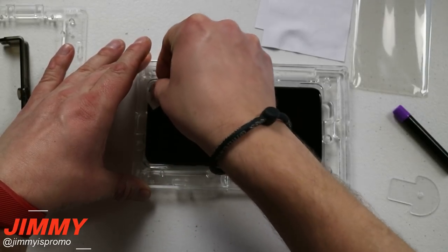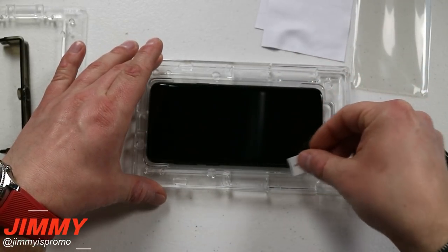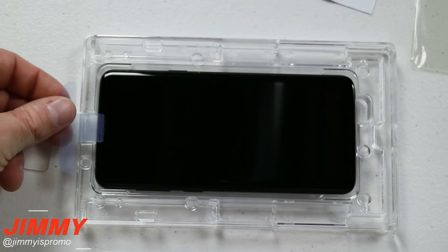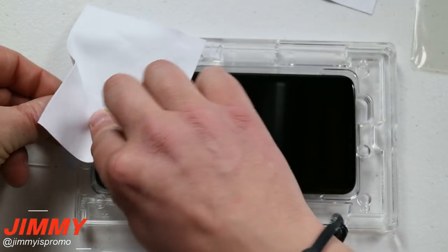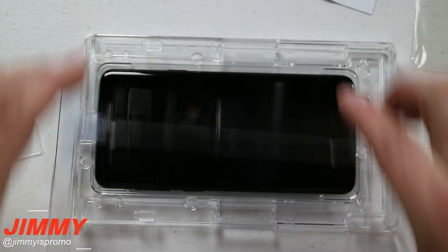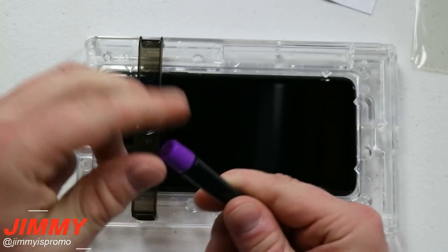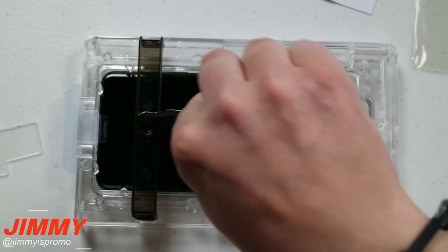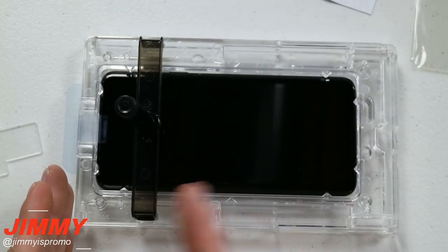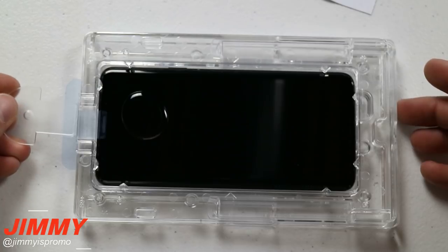Move on to the dust sticker and go all around — you don't want to touch the bottom of the adhesive and get any fingerprint, smudge, or oil on it. Now that the phone is completely clean, put on your little speaker guard using a microfiber wipe so you're not picking up oil or fingerprints. Then place on the very top piece along with your bridge. Open up the colored cap, place it right inside the bridge holder, make sure you're on an even table, then open it up. One of the final steps is throwing in your pin on the very top.